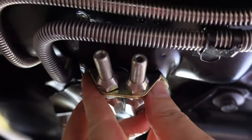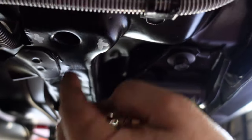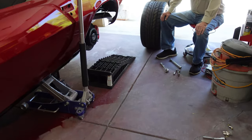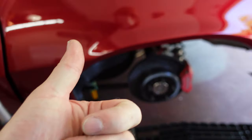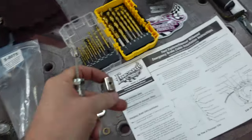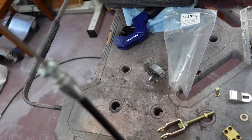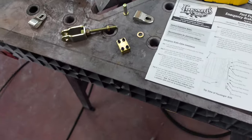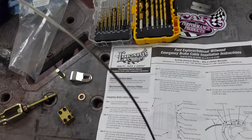So this will sit like that. Then the driver's cable goes up around the forelink and up and through there. And the other one will come over the frame rail and across to the other side. The next step's a little more dangerous, so I drilled out for that thing. I haven't put it in there yet, but we've got to attach the cables here in the back. This is the part that didn't make sense in the instructions — they say feed this thing in and connect this to this. You have to take the cable out of the sheath in order to do that. Why they didn't just do that from the factory, I don't know.